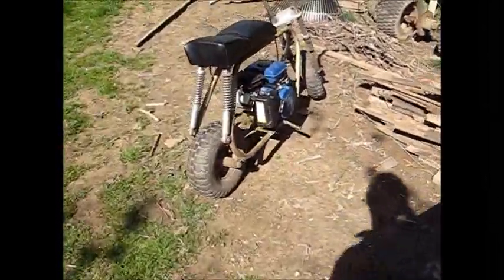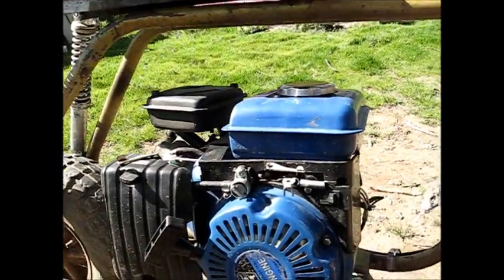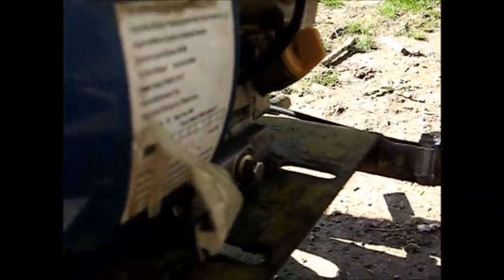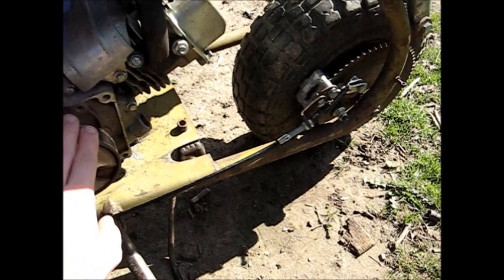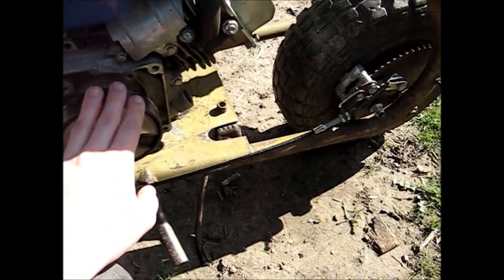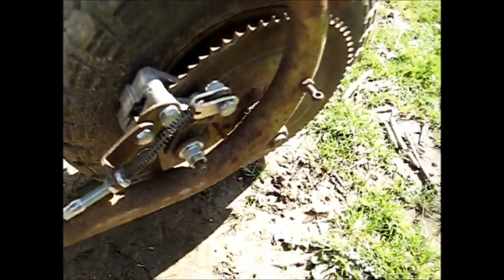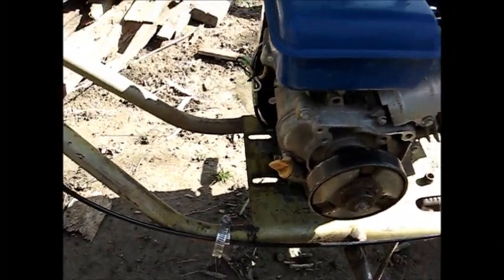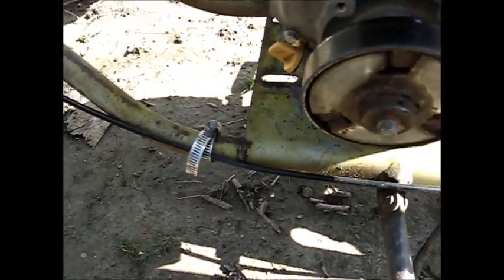The mini bike — the only thing I really did was get rid of that adapter. I filmed some video on that but I guess I never uploaded it. I basically drilled out and tried using some JB Weld to plug up the holes that were drilled, then drilled my own holes, so it's now properly lined up. I did have it riding until the master link bent and broke off. I've got some parts ordered, and as you can see I now have my brakes, which still need a bit of improving. I changed the oil because gasoline got into it — the oil looked pretty green, which I'm guessing is because my brother used two-cycle oil on it. And it runs pretty nice.